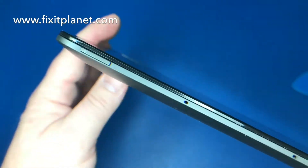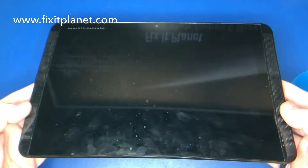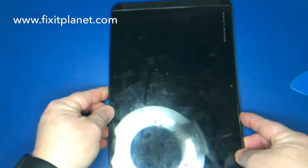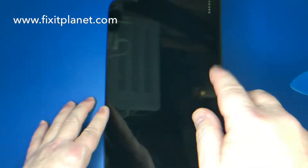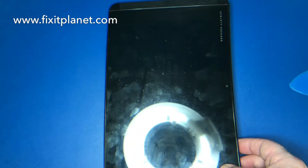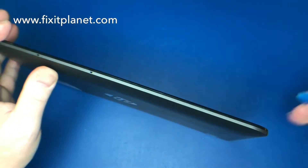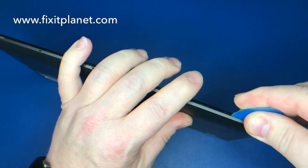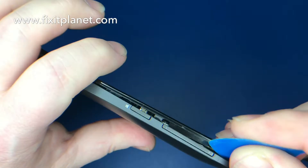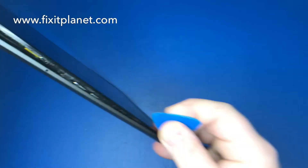This one is intermittently charging — not charging — so we're going to replace the charge port on it. Here's where the keyboard connects, and on that side we need to be careful because there's a cable running underneath here. The back just snaps on and snaps off pretty easily; you can run a pick through here and get it separated.